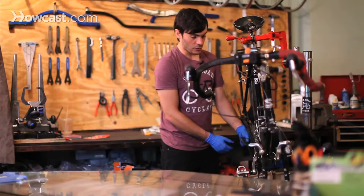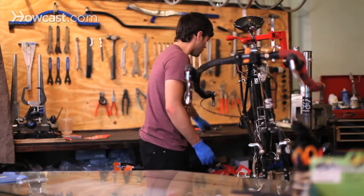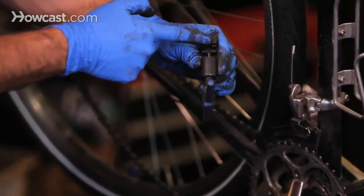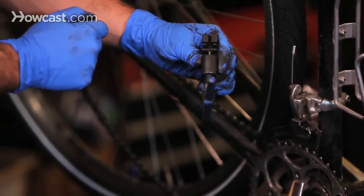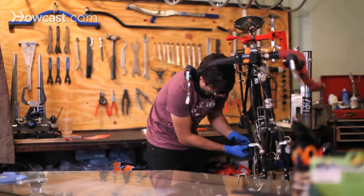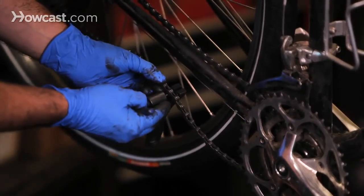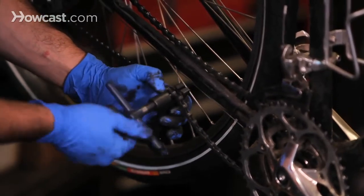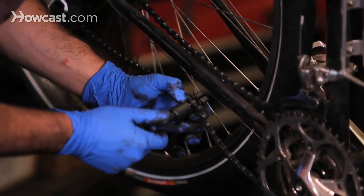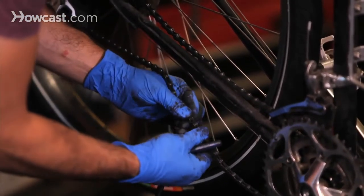When you're pushing a pin in and not using quick links or power links, sometimes they get a little stiff. That's where on your chain tool you have another ramp — you have two ramps: one for pushing the pin out, and one for making the pin not so stiff. Find the pin, put it on that second ramp on the back, and just push it slightly — not too far that it pushes through the side wall — and that makes it nice and smooth.